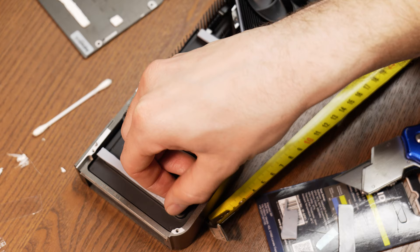Secondly, there's crypto. I don't mine with my card, but many do. It's well documented that memory temps can easily be pushed to the limit when mining, and many have had excellent results with swapping to new thermal pads. So if you mine regularly, I'd recommend getting some new pads on there. And finally, do I recommend changing the pads if you're only gaming? If you're into tinkering, yes. If you have any card easily reaching 100 degrees-plus with the memory chips, buy a single sheet for the face of the card and slap it on — it'll give you peace of mind knowing you're running optimally with a solid buffer to the thermal limit.